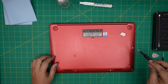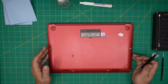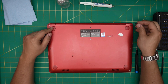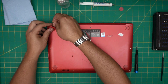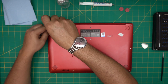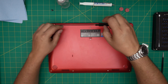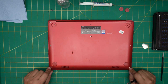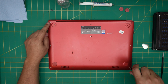On the bottom of the laptop you'll see a bunch of screws, including hidden ones. There are a few different sizes. Start by removing the obvious ones, then look for hidden screws under the back rubber legs — use the opening tool to lift up the leg, it has a little adhesive. Remove both rubber legs. Then remove the black screws on the bottom. The longest screw is the one at the back middle — keep that in a separate pile. The short screws are in the front row corners.